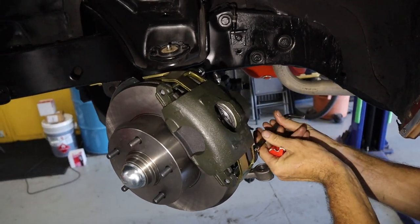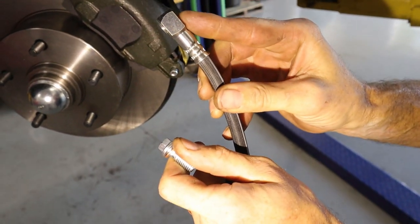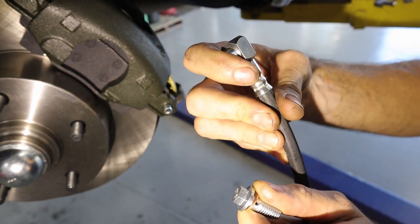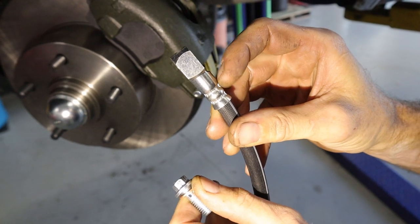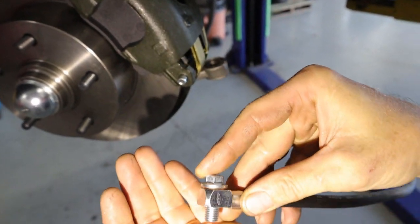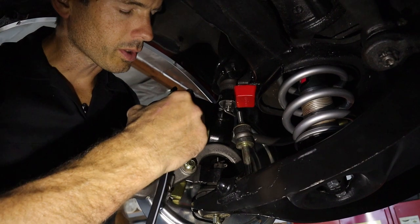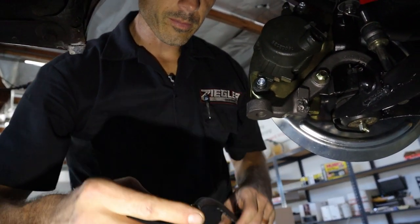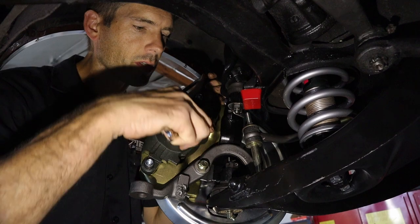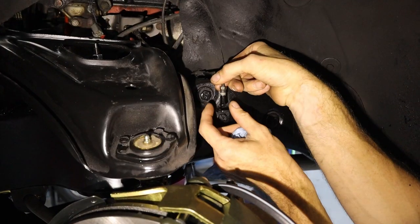The caliper has an offset — one side is lower than the brake line fitting, one side is higher. The side that's lower goes toward the caliper body so the brake line can reach and seal properly on the copper washer. Install it correctly so the brake line goes to the top, then tighten the banjo bolt — only 14 foot-pounds, don't get crazy. Try to keep the brake line straight as you tighten it. Now we'll put the brake line in, take the vacuum cap off, and thread it in snug to stop the leaking.